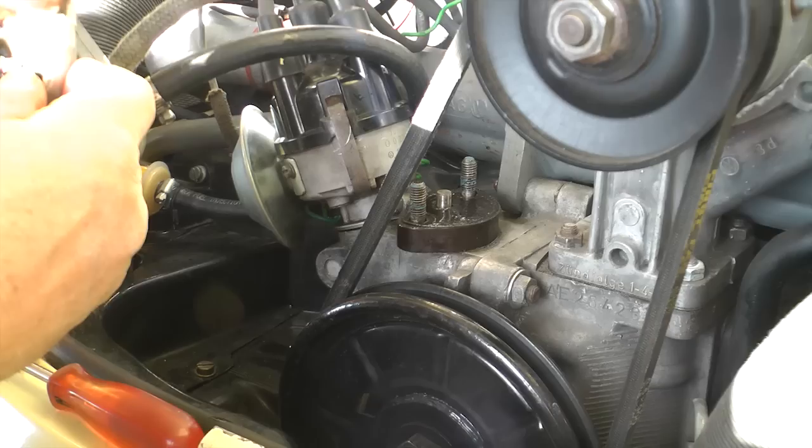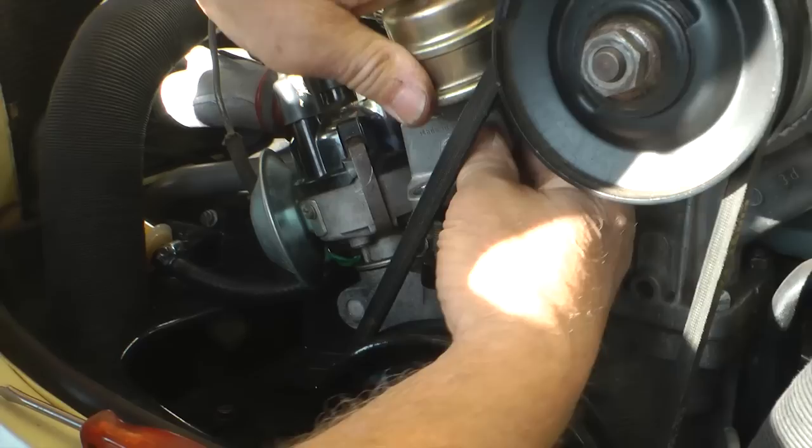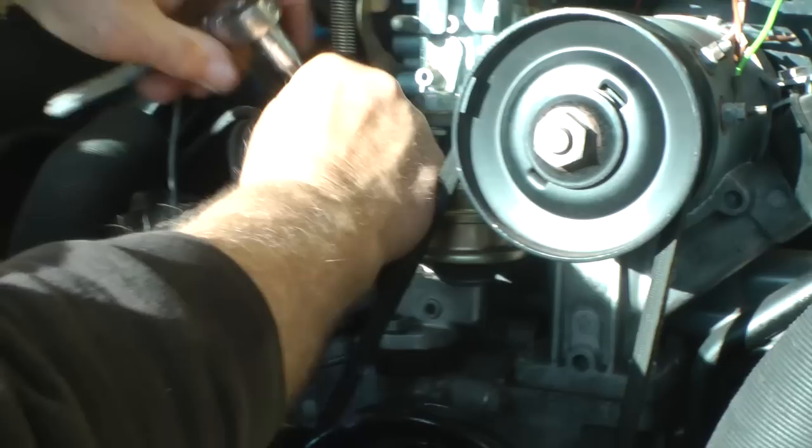Make sure you put your gaskets down — there are two gaskets for the fuel pump. You want to make sure when you put your stand in the block it just flops right down. If it gets stuck, keep sanding. Then put some wheel bearing grease up inside the fuel pump and put your second gasket down on top of the stand.